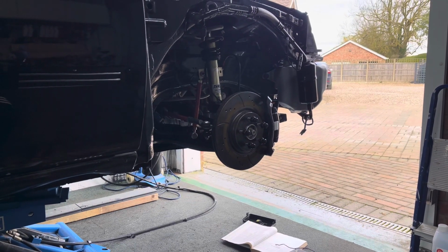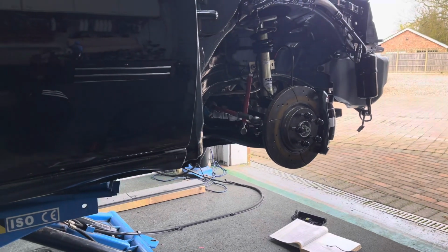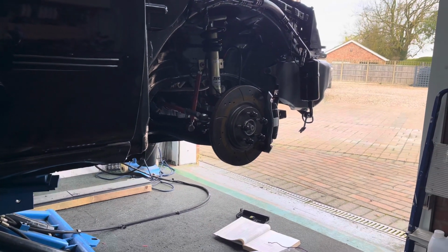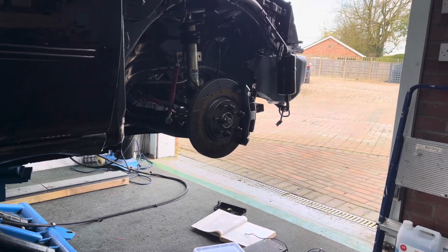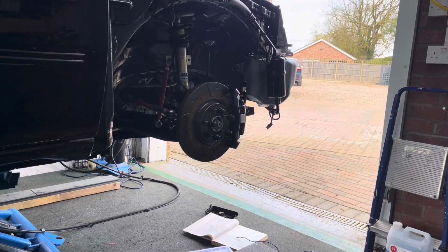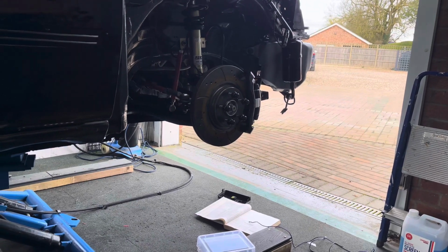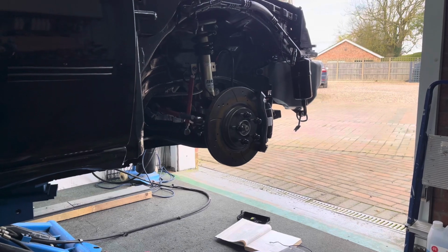I can't believe that. What I did was I hard earthed the alternator. So what I presume has happened is when I've painted the block and when I've painted the bracket, I've not accounted for the fact that the alternator earths through that. So what I've done is I've put a hard earth wire on one of the bolts, and straight to the main earth on the car, and it's working. It's charging.